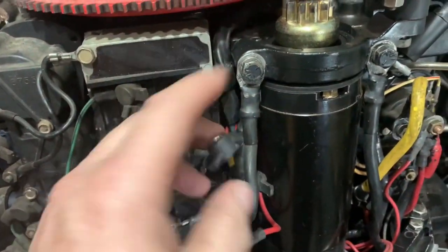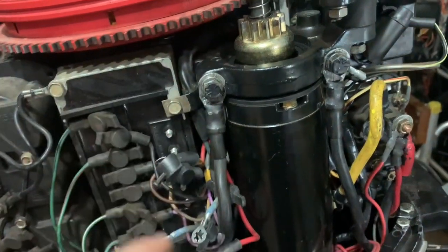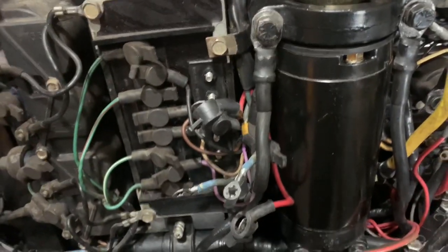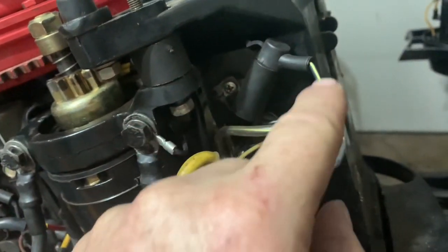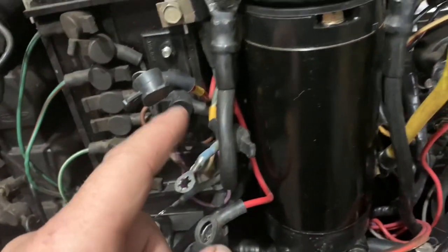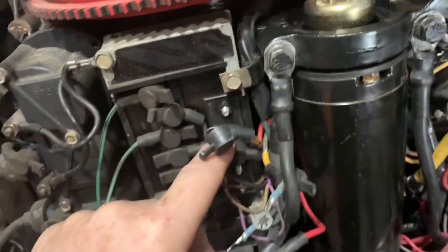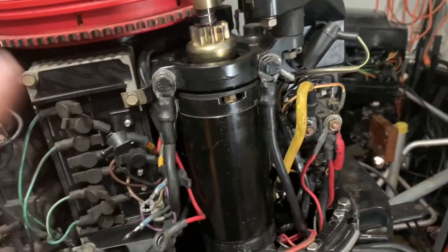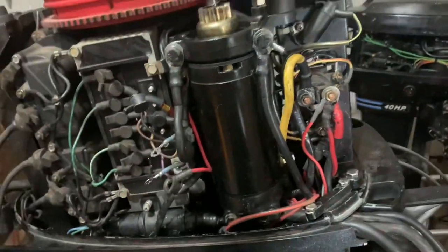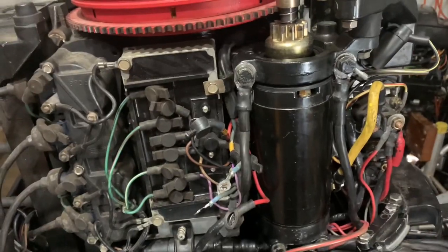For the record, I checked all of these leads to ground and got an infinity reading on the voltmeter — no continuity for any of these to ground, so that circuit is good. I also checked the kill switch, which has a black and yellow striped wire. I took that off and tried to crank it and got no spark, so I know the kill switch circuit is working okay. With the ohms resistance and the DVA adapter voltage readings, that stator is good. Next I'll have to check the trigger.